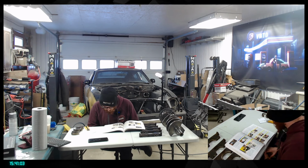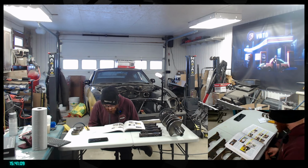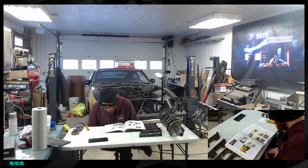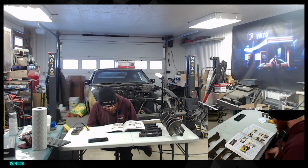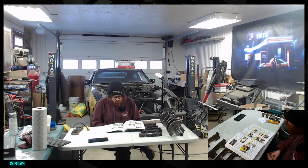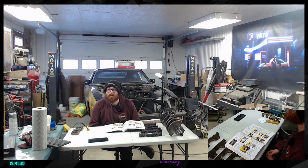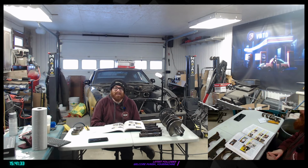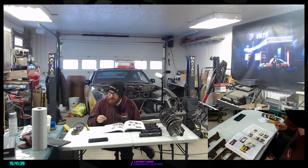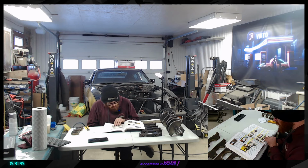So yeah, that's what I was saying. Also put the lower halves of the main bearings in the main cap. Use no lubricant whatsoever on any of these bearing shells. It will interfere with bearing clearance measurement. Once installed, wipe them with a clean cloth to remove any possible contamination. So that makes sense, that's what we want, and that's what we're going to do. After that, you can lube the bearing, I just mean the crank side, not just the crank. Yeah, exactly, okay, makes sense. So that's what I'm probably going to do, and they are using a small brush to do that. I might be using that, I will see later on. But yeah, I'm going to install them properly and dry.